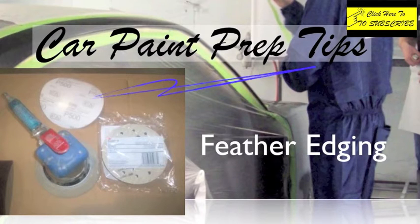That's where you take that edge, where your grinder was, your paint edge, and you basically take a hard edge and turn it into a smooth edge. And you're basically layering each layer of paint. So when you do this, you want to see each layer of paint. For example, on a car, you're going to have your undercoatings, a primer, and you're going to have your color and clear coat. All those are different layers of paint. And you want to try to layer each one at least 1/4 of an inch. It can be more, but you want to be able to see each layer of paint at least 1/4 of an inch.